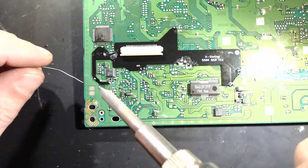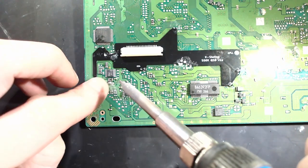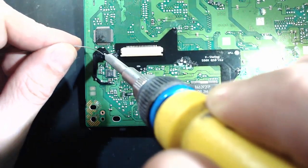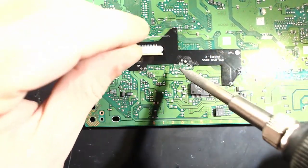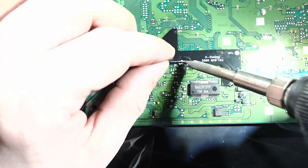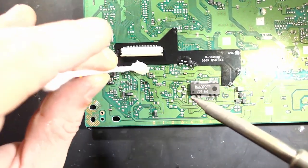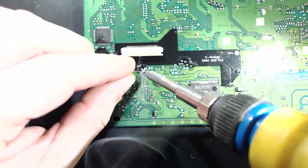Definitely very simple and convenient. Easy job to do. I think anyone could really get this PCB section handled. They made this install very, very easy. The pins might freak some people out, but heat the pads, lift the legs. It's all you got to do.